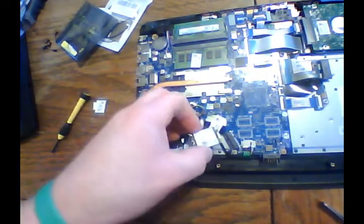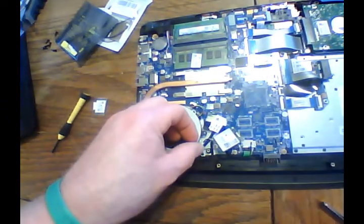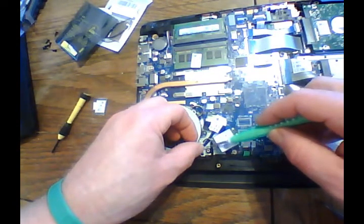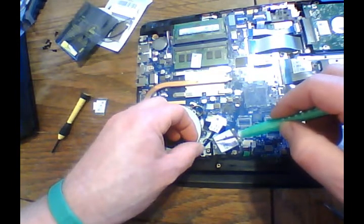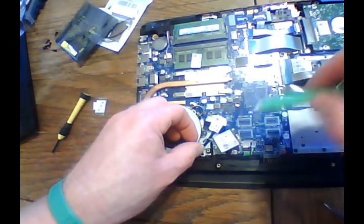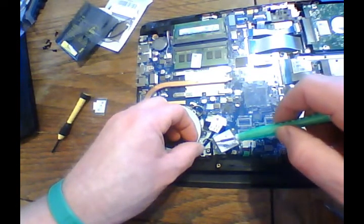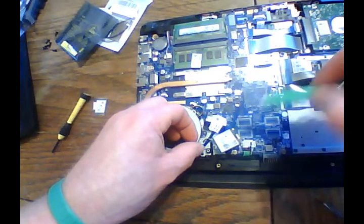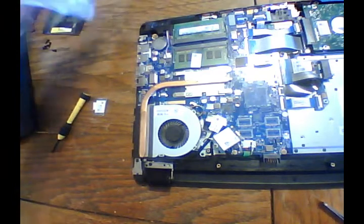I mean, this card's pretty resilient, but if you see, there's nothing underneath. Once that card is screwed down, which is where it's screwed down right here, there is nothing underneath for you to be pushing down with your fingers. And I've seen in some videos where people are just pushing down on this thing. Like I said, they're pretty resilient, but if you push down too hard, you can break part of the circuit in there, or even weaken it, and it can cause you problems down the line. Or you break it, and you've just wasted a $40 card. So we're going to do that, and then